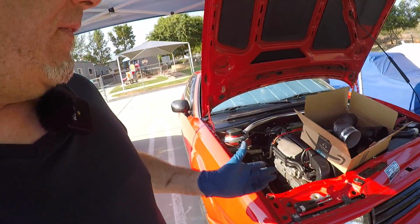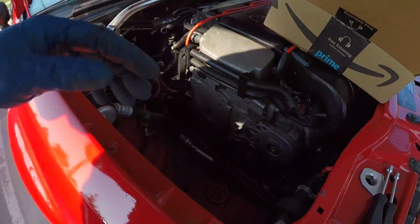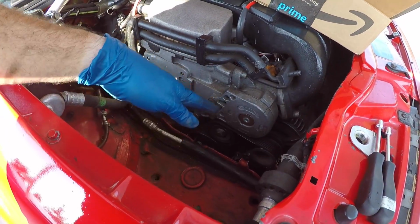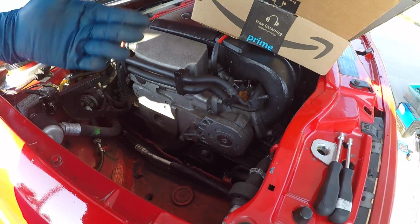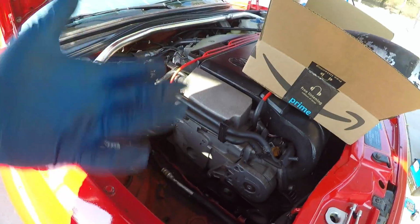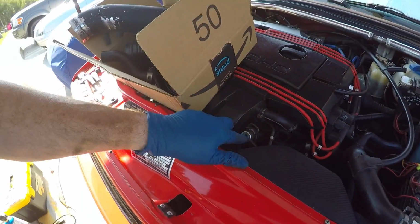I will film a little bit more of this stuff as we're actually getting into the supercharger stuff, but this tensioner has to come off. There's a little in-between sandwich plate that goes on there that secures the top part of the supercharger to this. There's a different idler pulley system that goes down in there. So there's a few things to do.